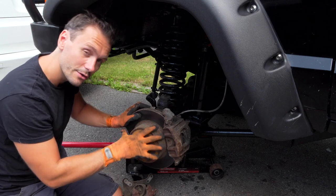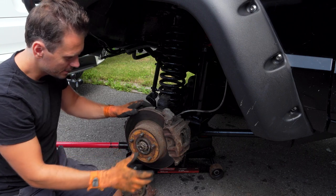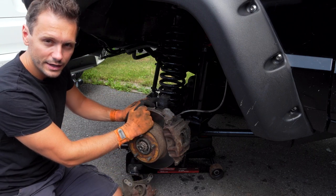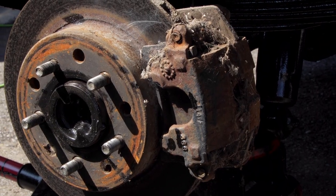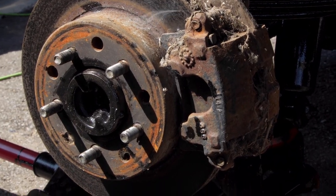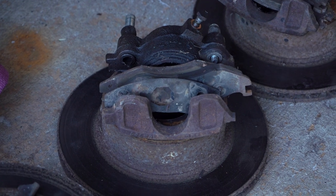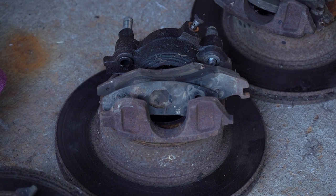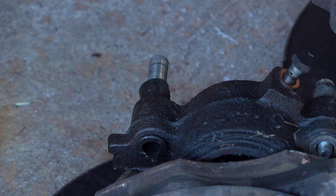In this video, you're gonna see all the steps, but this is gonna take several weeks to actually film. So what I'm gonna do is just take this apart, take it to town, put the wheels back on, and try to figure something out. We'll go from there. Look at these nasty things. These are the other rear brakes. Just nasty. Okay, here are the original rotors from the front. We managed to get them off. Just have to remove those two screws right over here, and they should pop right off.